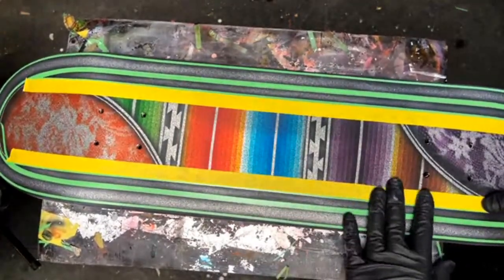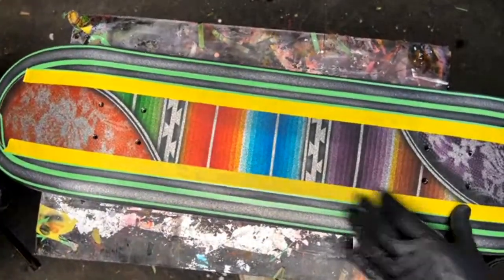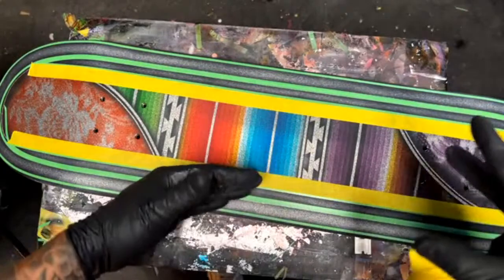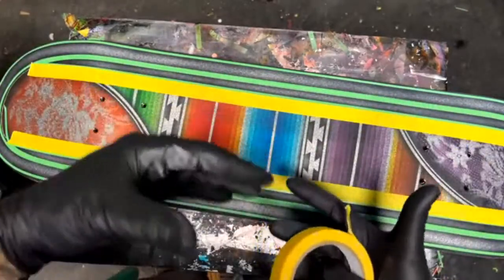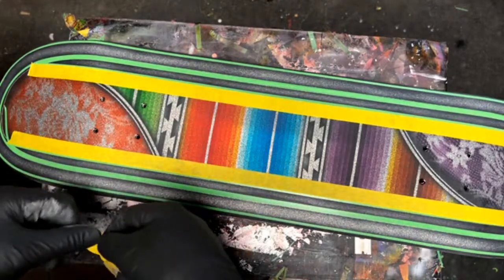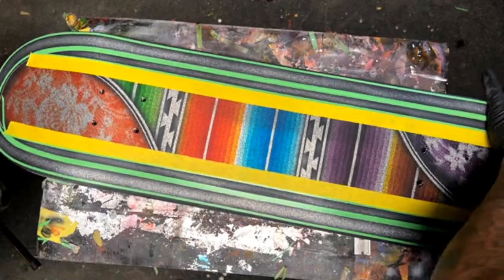But yeah, when you're first clear coating your candies, hit it with a couple of drier coats. That way you can get a little bit of clear on there to set up on top. When you start hitting it wet, it's not going to wet everything. It has a little bit of a barrier. That makes sense, right? To you, Ash? Not until you said it. Well, now it does though. Now you're all cleared up on that?